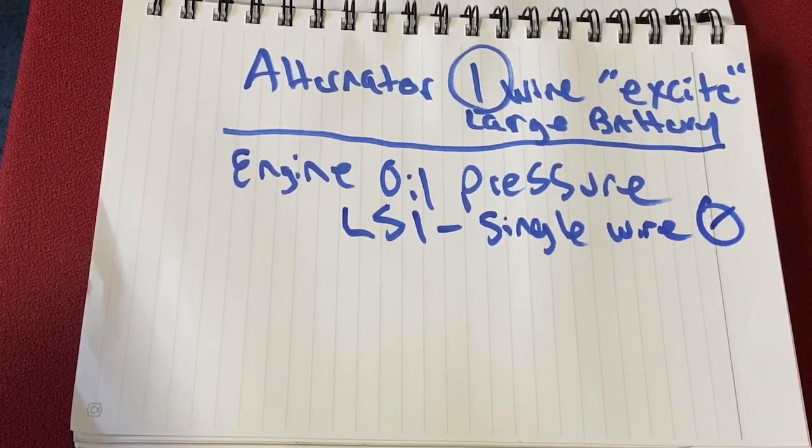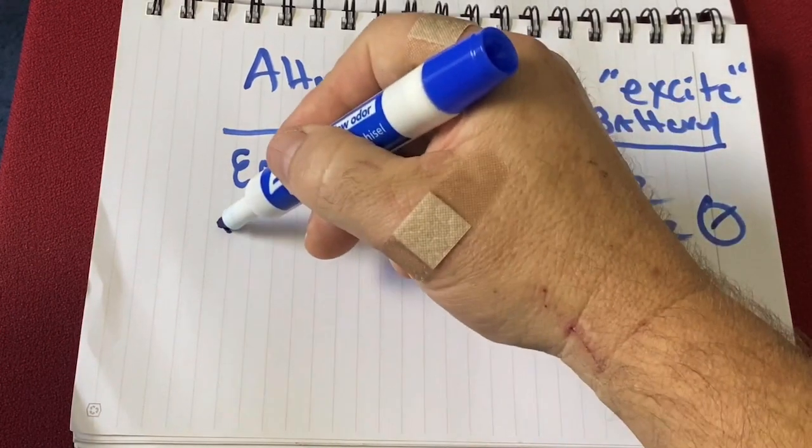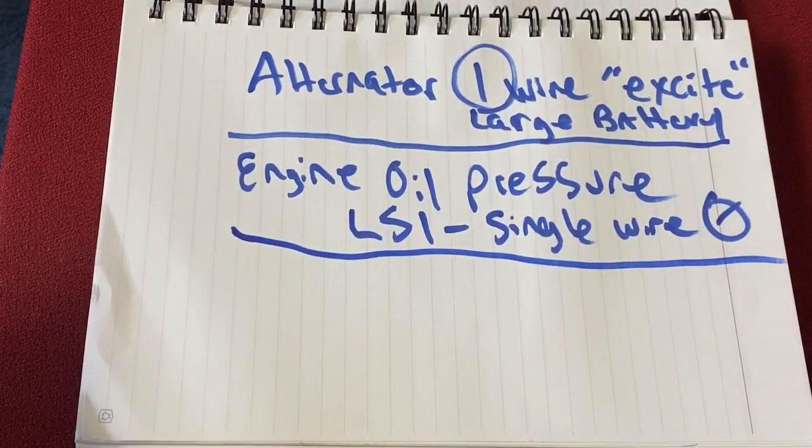Okay, so what's bad about that, not really bad, but you have to know that now the ECM really doesn't know the oil pressure. Now, some guys do some crazy fancy stuff where they'll actually run a splitter and run both senders, right? So you have one sender that's basically going to the ECM and one sender for your gauge. So if you guys know another way of doing that, it'd be interesting to know what you did on that. Please leave a comment below.